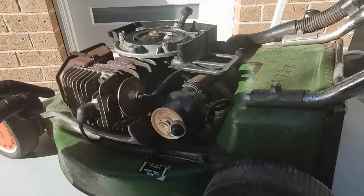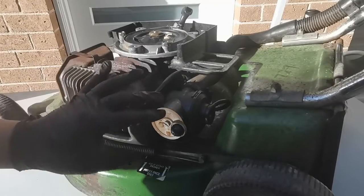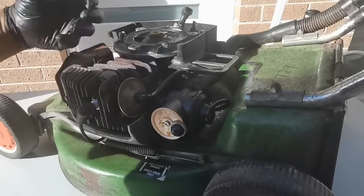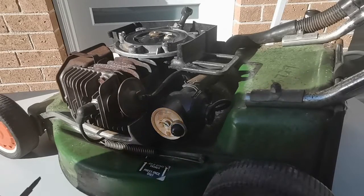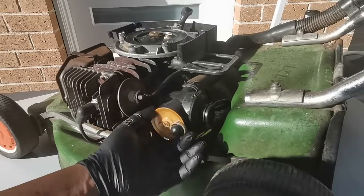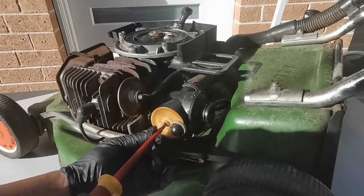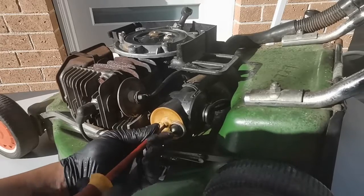It is very important to replace that o-ring on the starter, because that's where the fuel is stored on the first half of the cycle, before it goes into the combustion engine. So also the main reason this is still leaking fuel at the bottom of the primer cap is because the primer cap is already warped, and I think it's best to replace the primer cap with a new one.